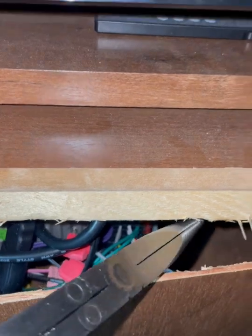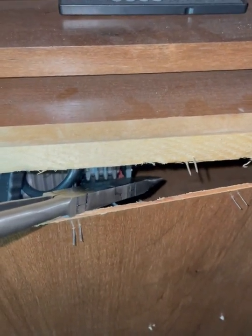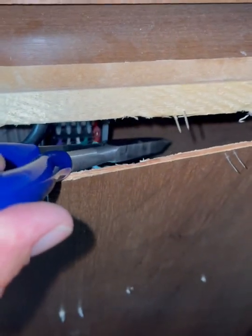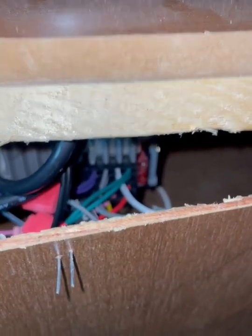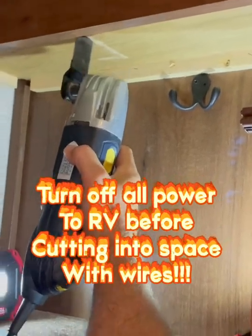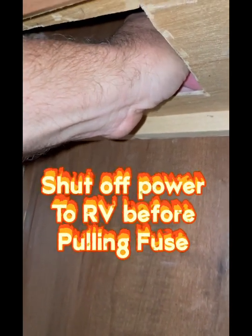What I'm going to do is cut in here underneath so I can put my hand up and pull out that fuse from the back side. Looking at the front of the radio, to the left side is all this space inside the cabinet that I can cut out to get to that fuse. It's really a difficult fuse to capture with any of the tools — I couldn't get it out even with the long prongs you saw in the video; it's just awkwardly attached. But that way you have access with your hand to the back side of the radio.